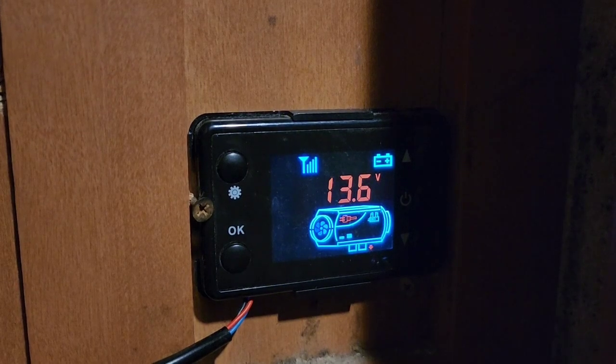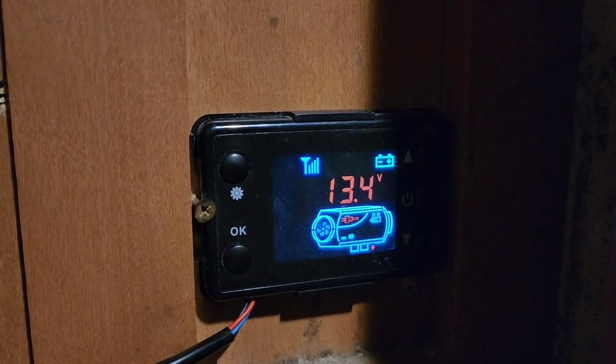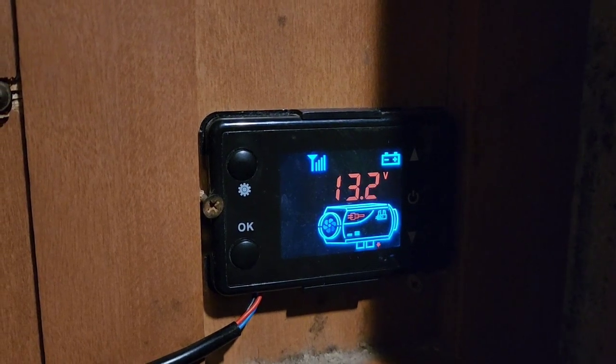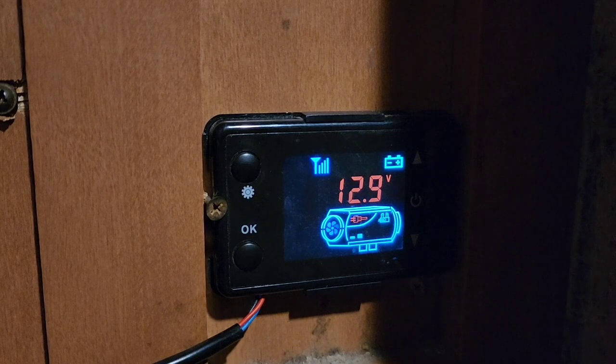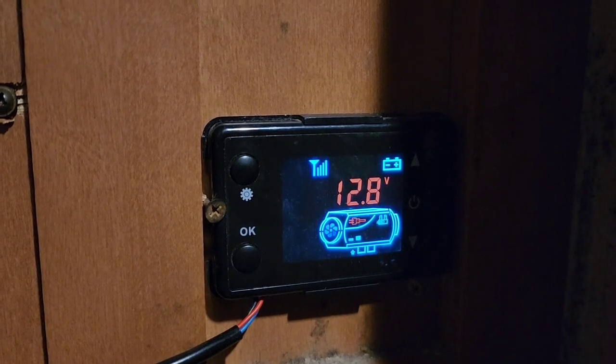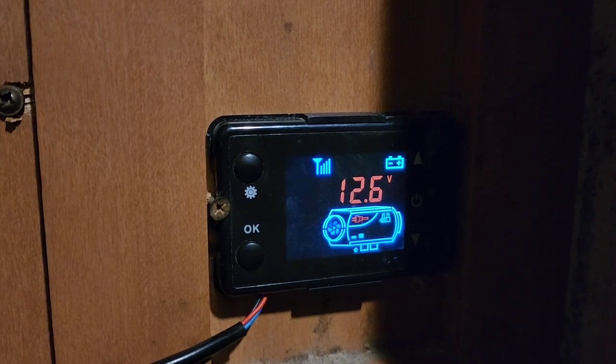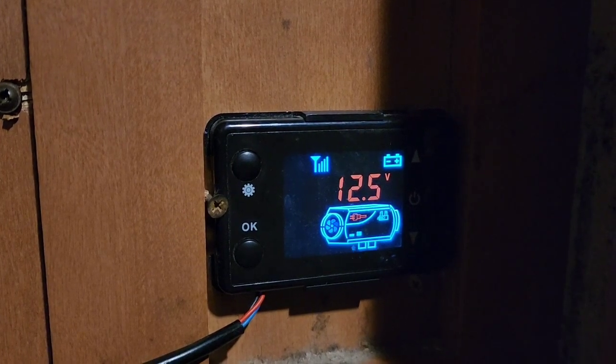It's not very long so it doesn't drain the battery much, but it is a significant amount of power — about 12 amps. That's why you see this voltage start to drop. But as long as it doesn't drop too low, we should be okay. It should start up fine, and as long as the voltage stays up around 12 volts, you're going to get a nice hot burn on the glow plug.